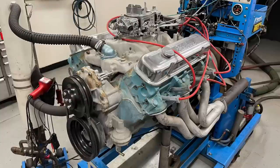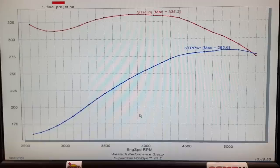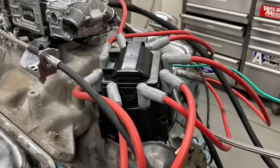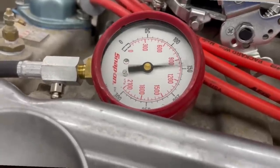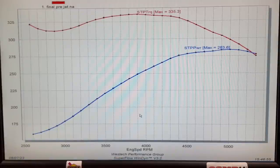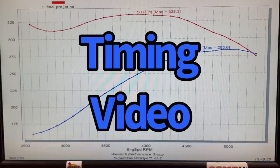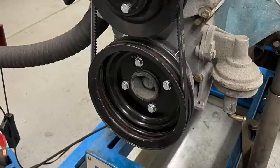Let's take a look at what happened when we ran our Pontiac 350 of unknown origin. When I got it, it was not running well. We did the basic things — spark plugs, distributor cap and rotor. It already had good wires. We did a compression test. After getting it firing evenly on all holes, we went through a timing sequence and found there was indeed way too much timing — which is unusual. We backed the timing down in steps and ended up making pretty good power. This is unusual since normally we have to add timing, which makes me think the damper may have slipped or rotated.